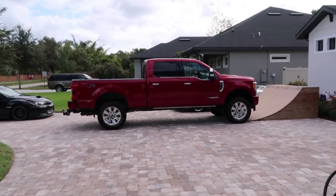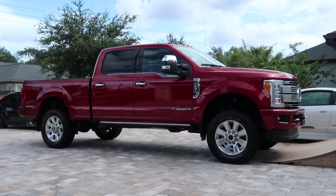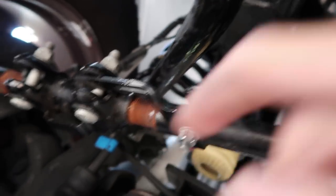The camera actually died last night but we got it all finished up. Brett was a huge help and now it's looking sick. Definitely quite a noticeable difference. I'm really happy with how it looks and it's going to look so much better once we get wheels for it. The only real issue — alignment was fine. I went and drove the truck. No weird noises. Everything drove straight but the steering wheel was off a little bit. I guess that track relocation bracket really didn't do much. So I found out there's actually a little adjustment right here where you just loosen these nuts and you can spin it and it moves this bar that attaches to the steering column, and I was able to straighten the steering wheel out from this. So now it's all good. I don't even have to take it anywhere.